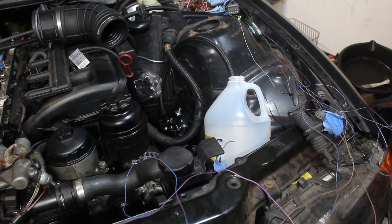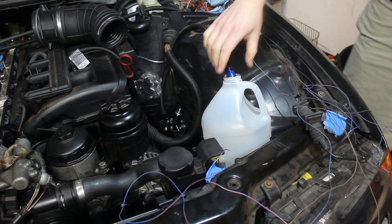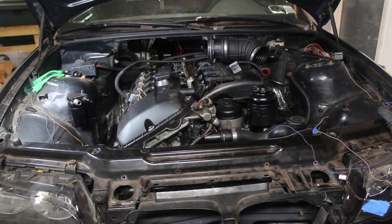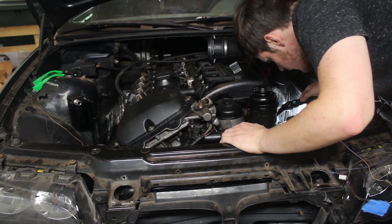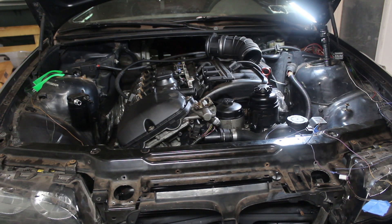Now I'm going to purge some of the fuel in the system just in case there's any debris or burrs stuck in the lines. The quick disconnect is on the fuel rail but it's hard to be sure it doesn't really click or anything. I've got some towels under it so I'm just going to prime it and see if it holds. The regulator looks good — oh, we are leaking. Tighten it up some more I guess. Thankfully, tightening up the fittings got rid of all the leaks.